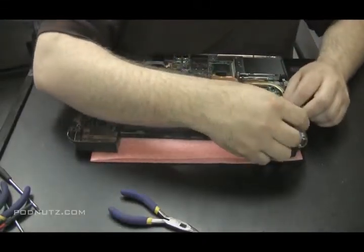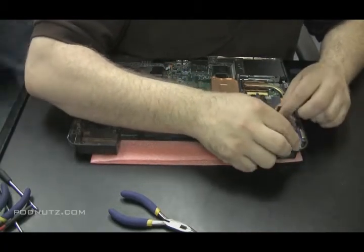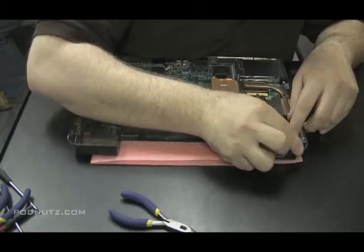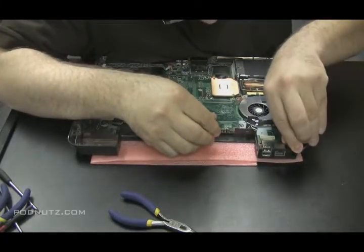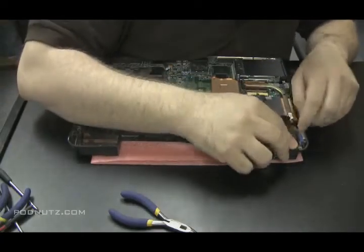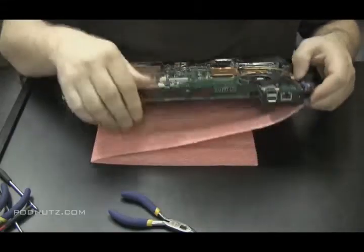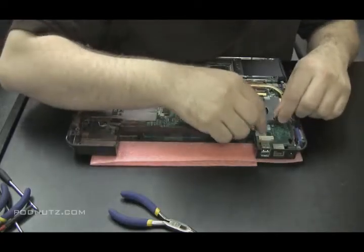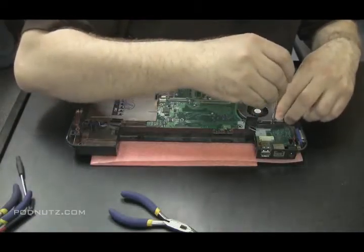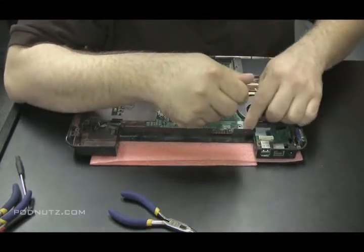Plus, you have the flexibility of that wire. So you could actually bend that pin around in the middle of the jack, and because it's a wire holding it together, you have some flexibility. It's not brittle, so it's not going to break as easy. Now it's just basically time to put everything back together. Kind of put everything back exactly the way it was. There was a screw that was loose there for some reason. Just tighten up some screws. Fasten that tape down.